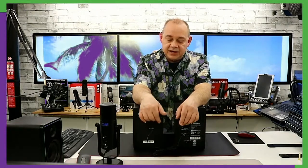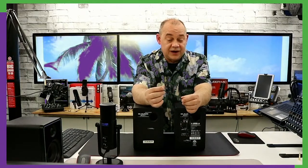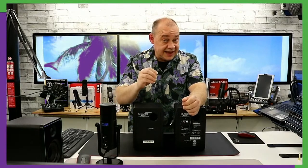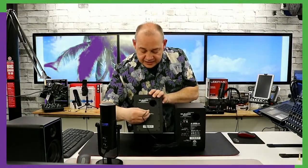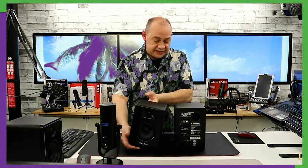Now, they could have gone with push-down terminals like Mackie did, and some companies use, you know, this, which is a standard mono. It's an actual speaker wire. People are worried about the size. The run is not very long. The bigger the run and the more power you have to run through it, the thicker the wire has to get. But proportionally for the amount of wattage that we're pumping through these guys, which is loud, but technically speaking, not a lot, it runs through these wires, no modifications required. This is perfect. Now, these are two-way speakers, so when we turn back around here,